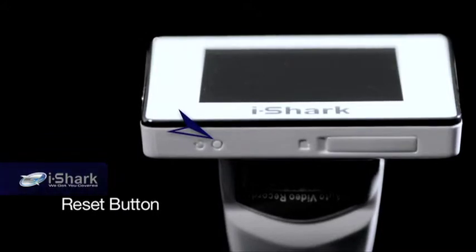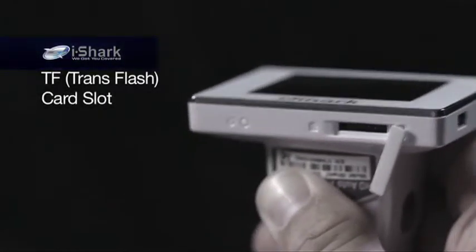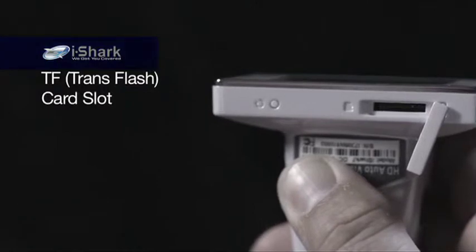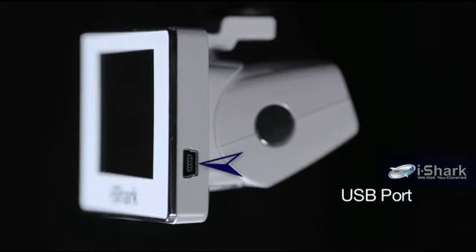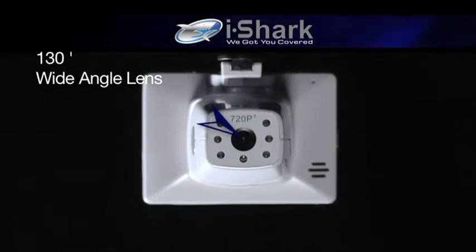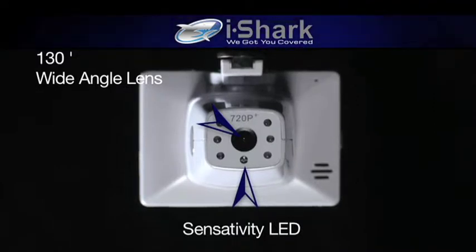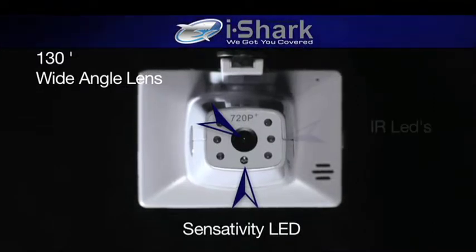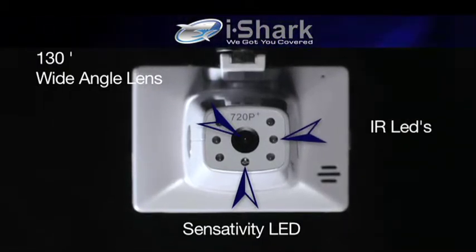Reset button is used to completely reset the camera's operating system. TF, or trans flash card slot. If you want to use a TF card, it will be inserted into the camera here. The USB port will be used to charge the camera and transfer data from the camera to the computer. 130-degree wide-angle lens will provide you super high-resolution HD images. The sensitivity LED helps the camera determine the level of exposure needed for the viewable images. And finally, the IR LEDs provide you usable images in nighttime use.